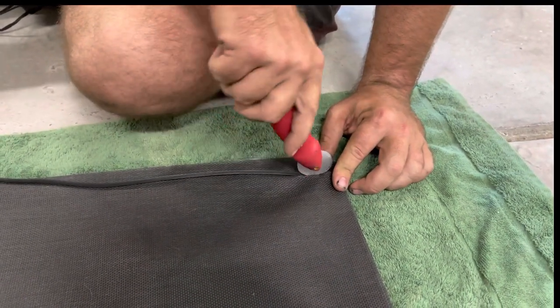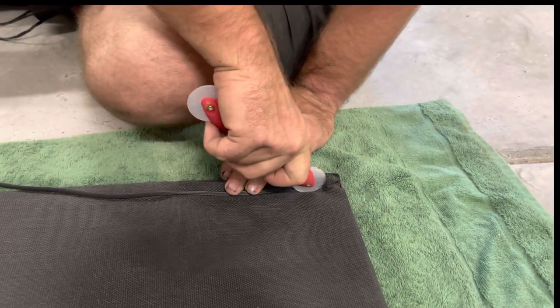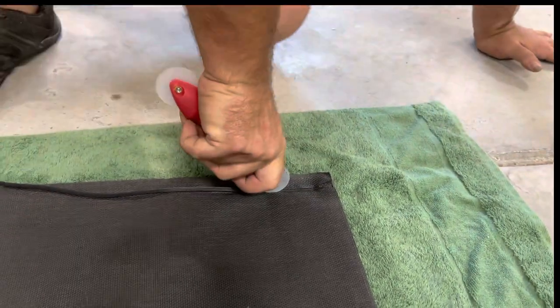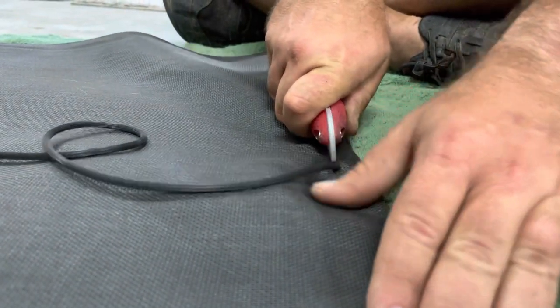I like starting in the corners — you'll roll it down the edge, creating tension at the same time and pushing it into the screen frame. This is what's going to hold your screen in place. Now we've got our screen installed into our frame and it's time to put it in the window.